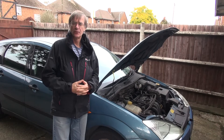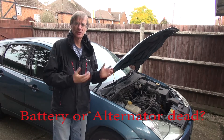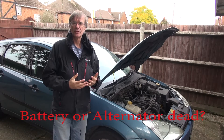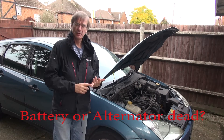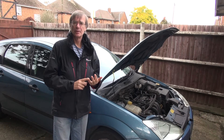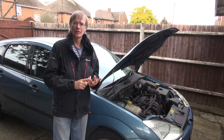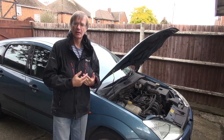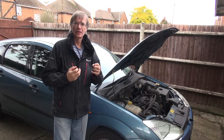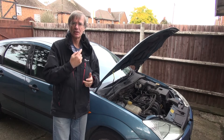This is the daughter's Ford Focus and she's having problems — every morning she needs to jump start the car because the battery is losing charge. There can be several reasons: one, the alternator has failed and isn't charging the battery; two, the battery itself has died through old age; or three, something on the car is slowly draining the current out of the battery overnight. I'm going to go through the things I would check to identify which of those is the problem, starting inside the car.